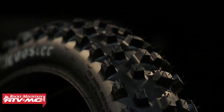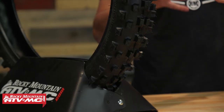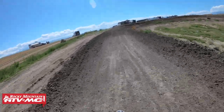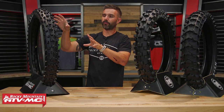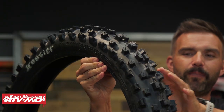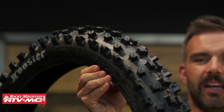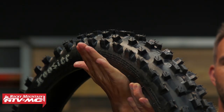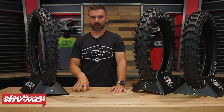With the front tire — the 25F I raced last weekend — the spread-out tread design cleared mud really well, which mattered at 80 Acres where early morning conditions are basically a mud race. Braking was notably strong; the tire just bit into the ground and gave excellent stopping power. The side lugs have a nice round profile, and Hoosier purposely designed those side lugs to angle outward rather than upward, so that as you lean the bike over the lugs contact the ground as early as possible to maximize the contact patch and grip.